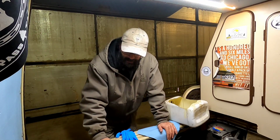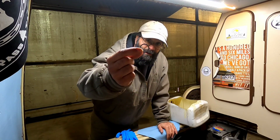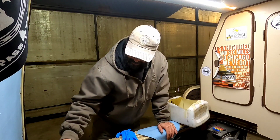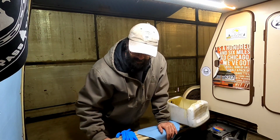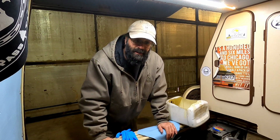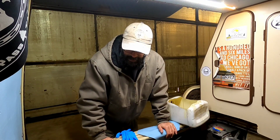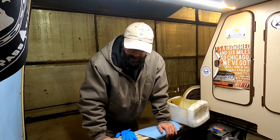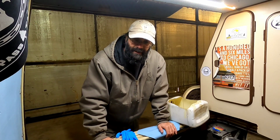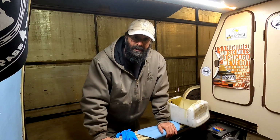The other thing to caution you of is that nowadays they put these little oil gaskets around the O-ring here for the oil plug, and sometimes they're crush washers and they go bad, and then you try to reuse it and you make oil spill out slowly onto the ground over time. So it's always a good idea to change that little O-ring. The older style cars had plastic or rubber and different styles, and they weren't as temperamental. The rubber ones you don't need to change at all.